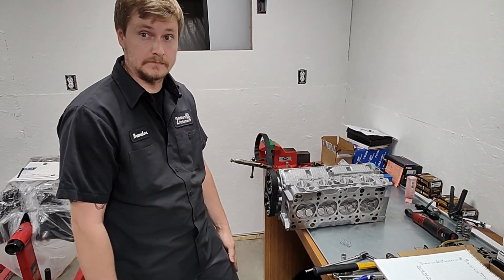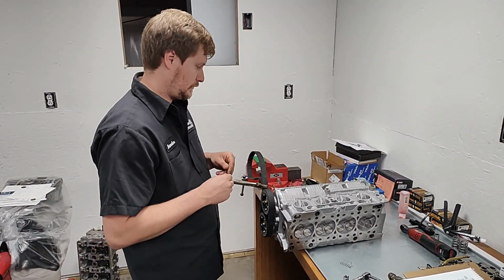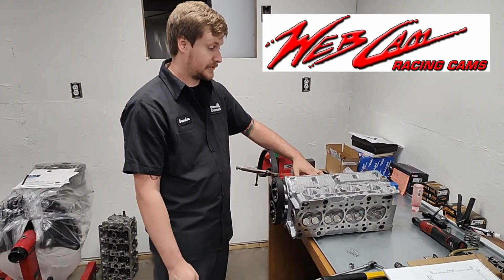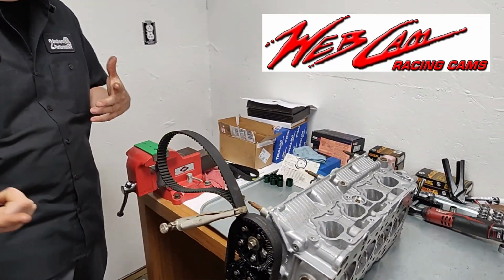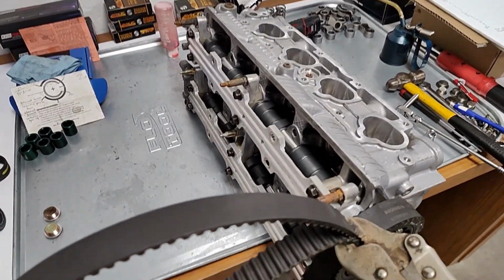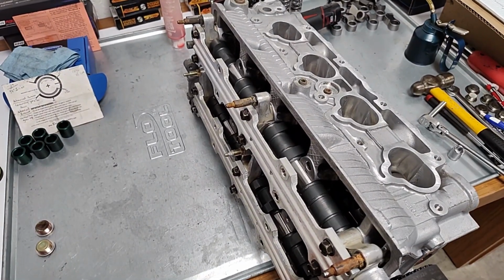You're talking knife edge of performance here. Correct. This isn't a daily driver getting groceries. This is going and getting a trophy. Yeah, these are billet two-lobe cams. They're not a reground cam. I mean, they're full billet steel with custom extended pad rockers, and stainless and Inconel valves.